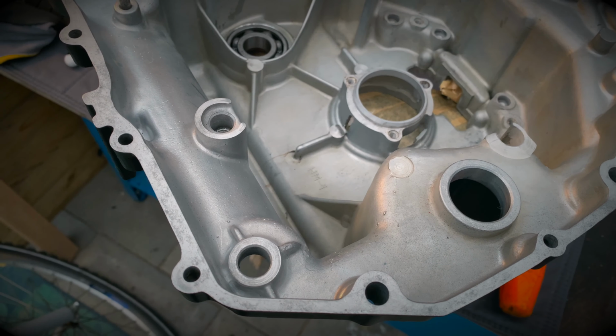Okay, just tightening these. Put some blue Loctite on. Don't want this coming loose. Just want a quick look again. So, stator's in. I think the battery on my torch just went again. Camera overheated, I mean. That's in. These are torqued. That's three behind. I've had a look with a mirror. And we can spin it round.